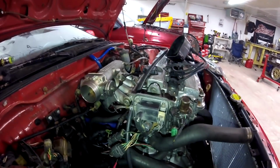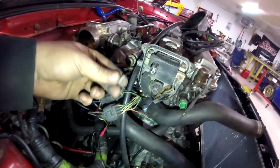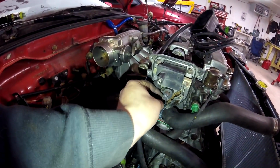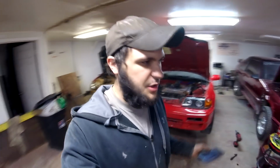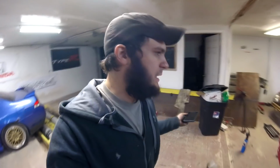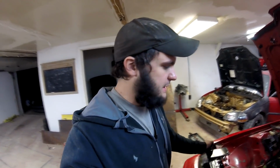And I also found out that there was a screw right here that had backed out from somewhere. I don't exactly know where this came from. I'm sort of assuming this was the rotor screw, and then the rotor backed out and started malfunctioning and having issues. And with the rotor dancing around in there, it probably flung some stuff around and damaged the CYP sensor. So I'm going to throw a new CYP sensor in this distributor quick, and I'm going to throw a new rotor on with a new screw and some red Loctite.